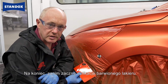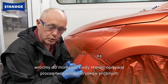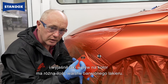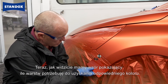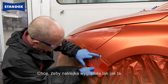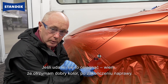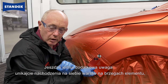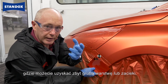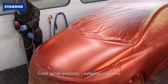Before I start application of the tinted clear, I want to take you back to earlier in the film where Harold was talking you through the process of producing the spray out cards. He explained the importance of the different layers of tinted clear in giving us the colour position. As you can see, I have a guide as to how much tinted clear I need to make the colour right — my target is to make this sticker look like this one. Avoid overlapping on panel edges where you might get a fat build-up or a run, because if you get that, it will be too dark and you'll never polish it away.